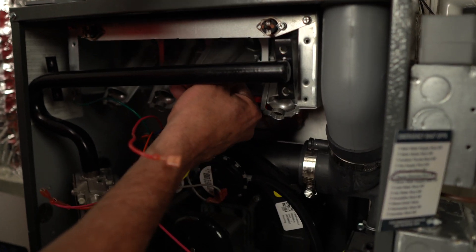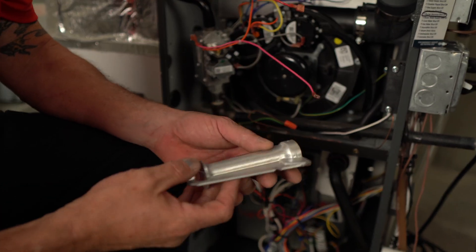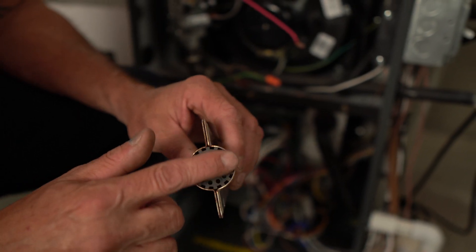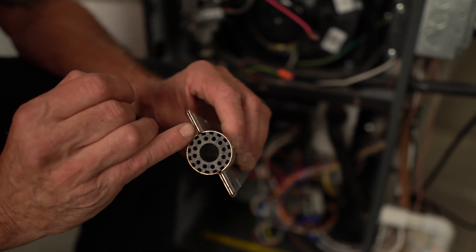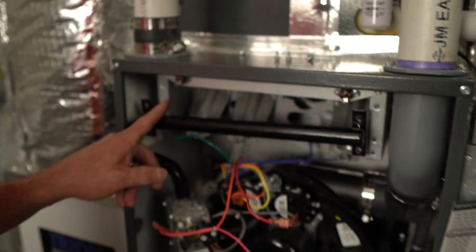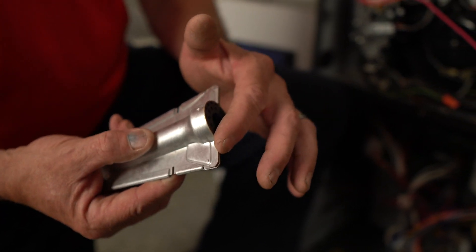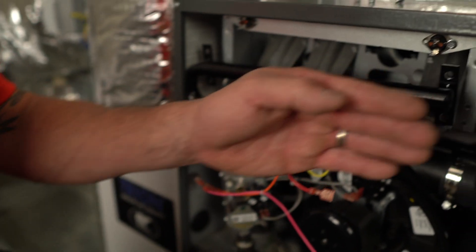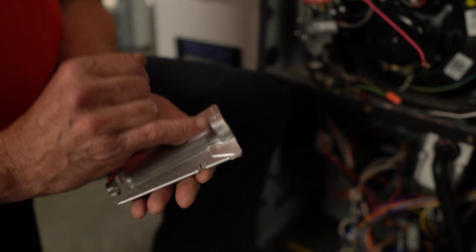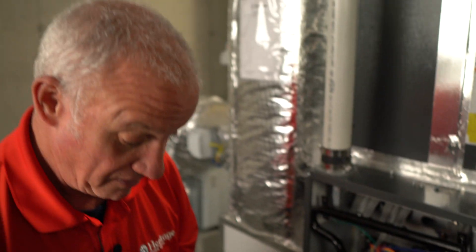We're going to remove one of these burners. The burner, as you can see, is actually quite simple — it's just a hollow tube. The parts we want to clean are this surface here, and more importantly these little slits. The ignition for these burners occurs only on one end, and the burners carry the flame from burner to burner through these slits — one ignites the next, going from left to right. It's imperative these get clean, because if they don't, only one burner will light, and the others will just be putting gas into the system until it eventually ignites.